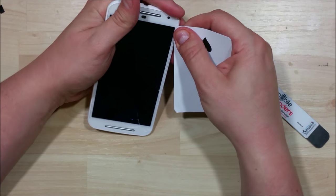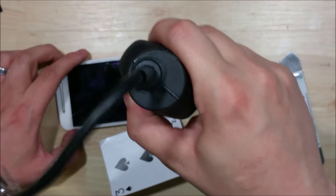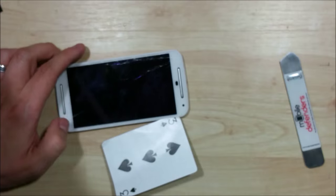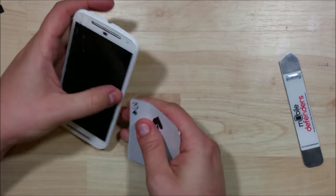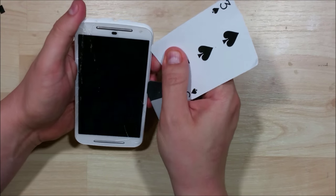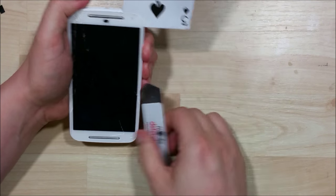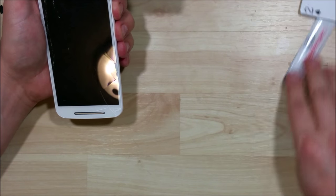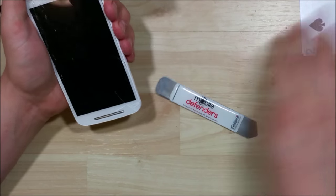These can still be tricky when you're moving around. It's not much like other phones using foam or rubberized double-sided adhesive — this is a much more strong glue. Another nice thing about playing cards versus guitar picks is when you heat it up, they don't tend to melt and deform. These corners can be a little bit tricky. The speaker grill is actually put into the mid-frame itself — it clips in, so you want to put your card over it instead of trying to go underneath it. One thing you can do is use a bit of a sawing motion.